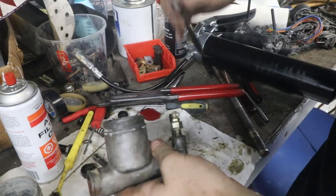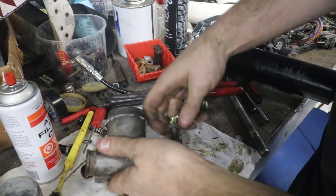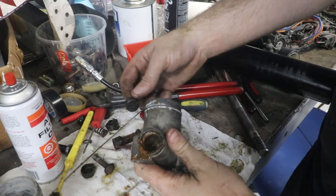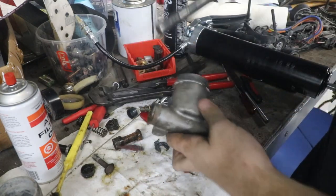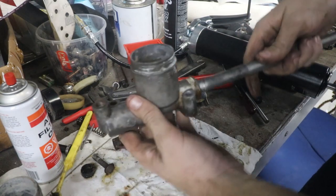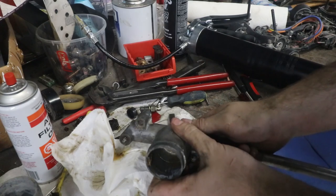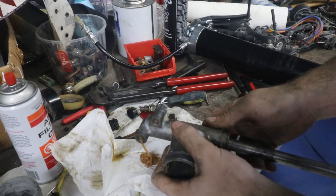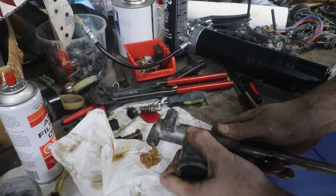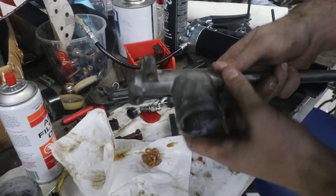The easiest way to do it is you get the spanner, take the fitting off. Inside here now is a little rubber boot, one of these things. What I do is I get a piece of steel that's a nice fit in there, put the piece of steel in, and then I'll get a piece of paper tape. We push the piece of steel in and it pushes back out like 90% of the grease that we squeezed in there, which makes it about 100 times easier to clean later. We don't want to squash it too hard — there's still some more parts in here.